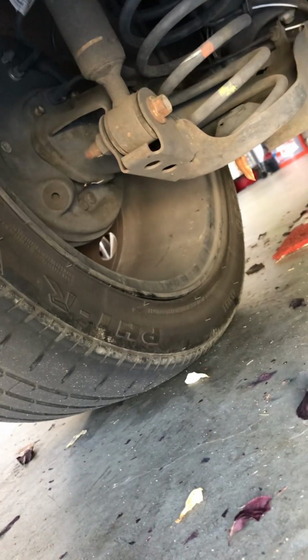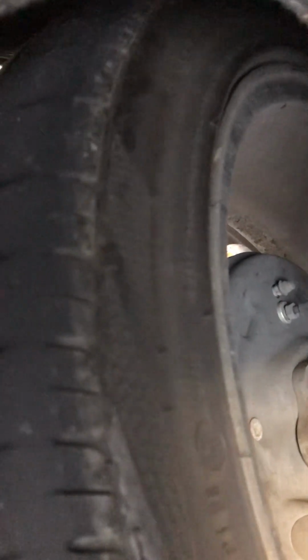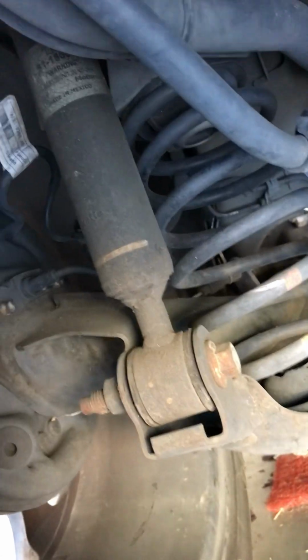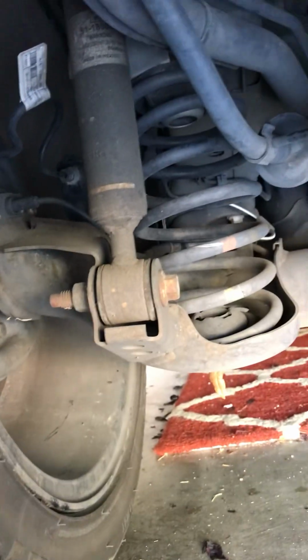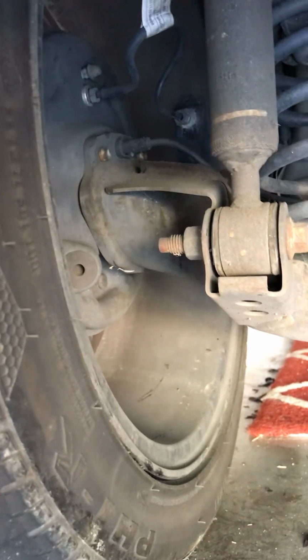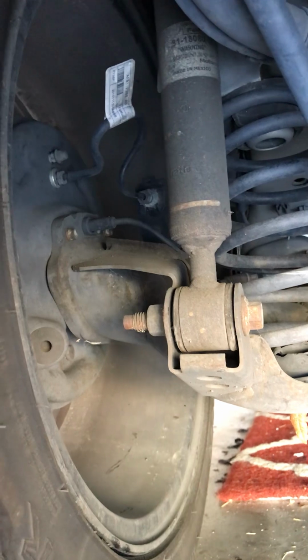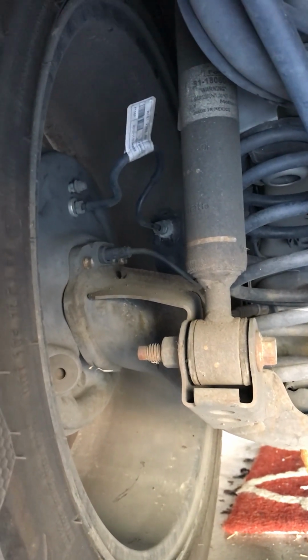But oftentimes, maybe about half the time, less than half the time, but maybe 40% of the time, yeah, you can see the brake line going in at the top up there. That's the drum brake. And above that is your little bleeder nut for bleeding the brakes. But you see the brake lines go all the way to the front of the car, obviously, to that same cylinder. And this car has ABS, so there's a pump somewhere, I can't remember where it is in this car, that has all the lines coming in, and this car also has wheel speed sensors. When it senses that one of the wheels is slipping, it activates the anti-lock brake system, and that starts pumping the brakes, because that's the best way to stop when you're on something slick.